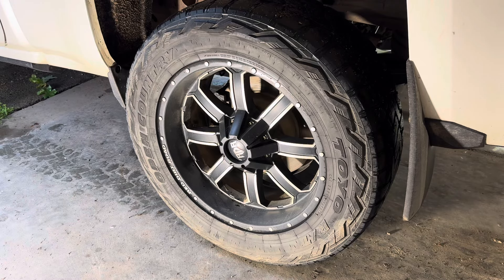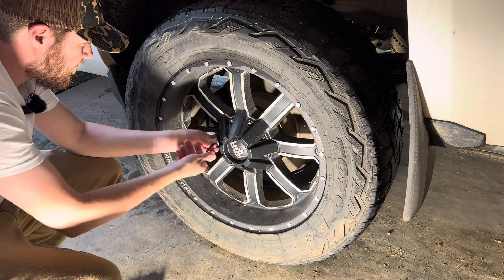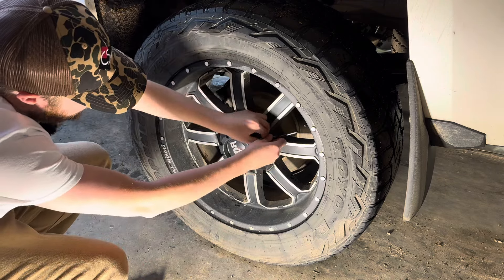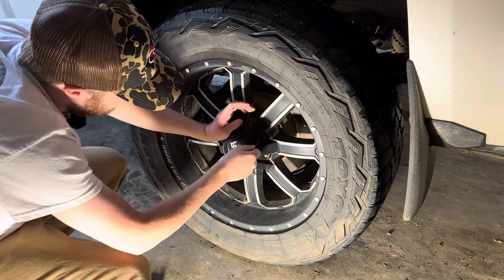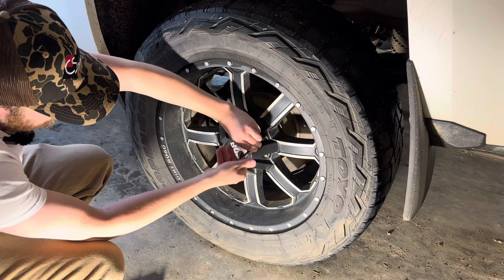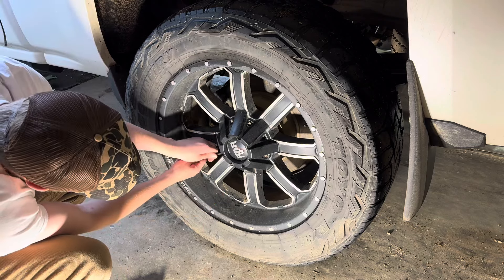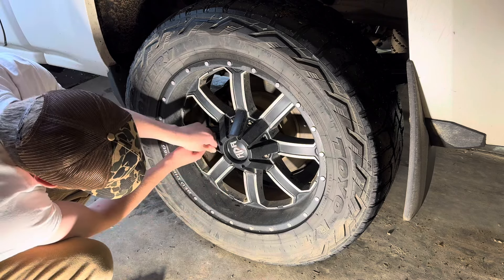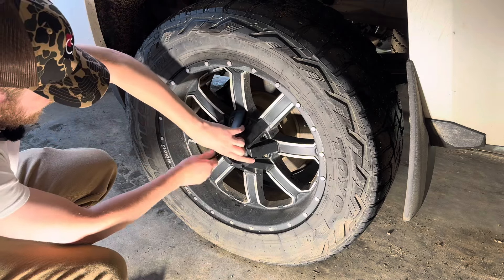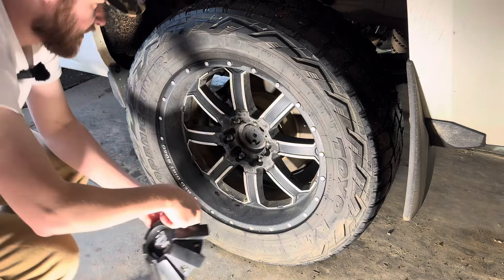This is a relatively simple job. I've got some aftermarket wheels, so I'm going to need to get in here and remove the covers for them. To remove my wheel, I need to remove this cap — it has two bolts that hold this cover on, the rest are fake. I've got a special little socket to fit the lugs on here, and it looks like a 19 fits it perfect.